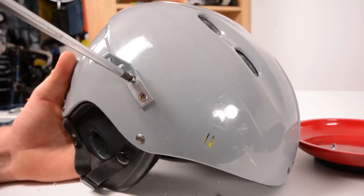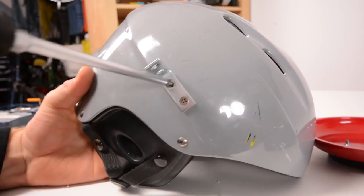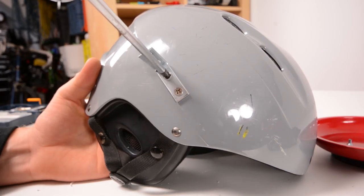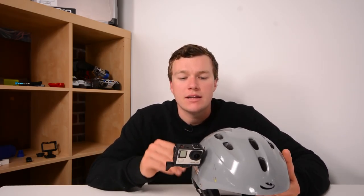The reason it's important to use a short bolt in this step is that you want to make sure those bolts don't stick out on the inside of the helmet shell. These helmets have about an inch or half inch of foam inside them — that's the crumple zone. If you crash, that's where your head will compress before it hits whatever surface you hit, and you don't want to crush into that crumple zone and then hit a screw head or a sharp screw.